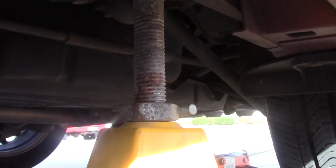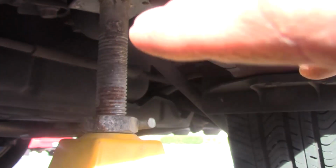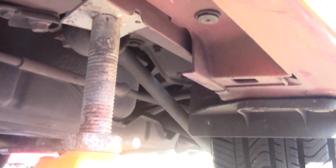So I'm taking this jack stand, which is my least favorite jack stand that I don't really like to use because it's obviously plastic. But it is good enough for these purposes because I'm not going to be getting under the car. And I don't plan to have it up any longer than I need to just get the wheels off and rotate it. So we're going to go put this under the same wheel on the other side.